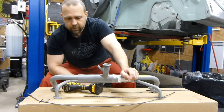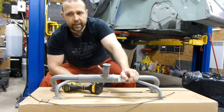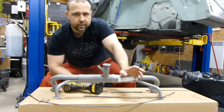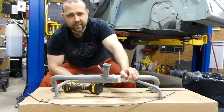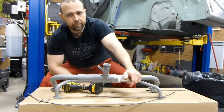Some of the symptoms you may see: you could see a symptom where you're driving on the highway — it has to be somewhat cold outside usually — you're driving around town with no problem, then driving on the highway for a longer period of time, you get off the highway, and then the car wants to stall. That could also be an indication that there may be carbon buildup in here.